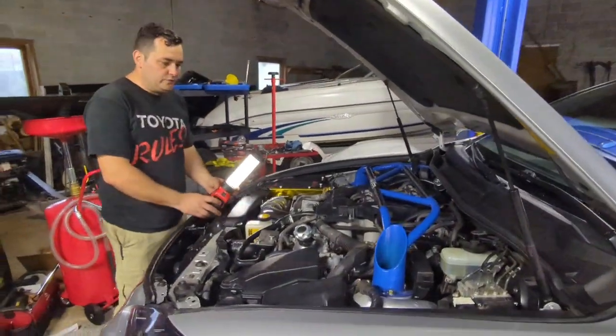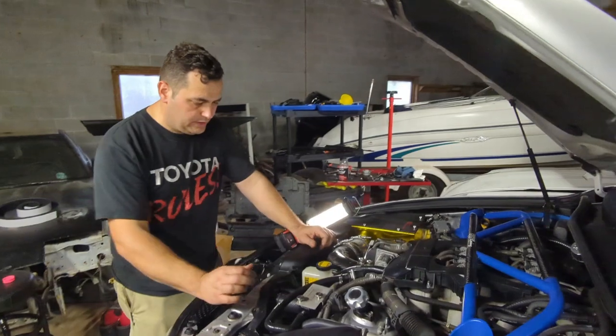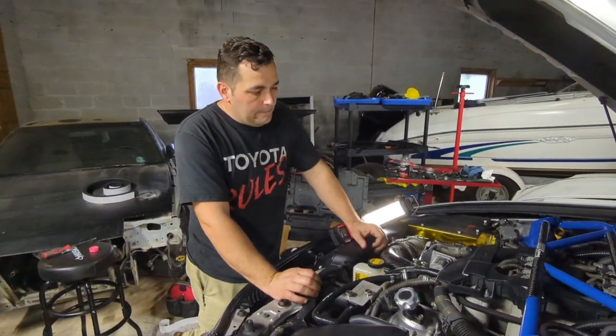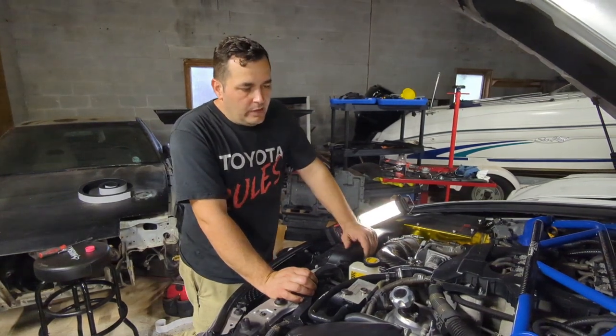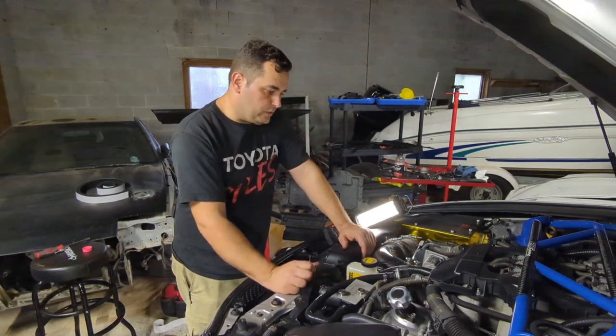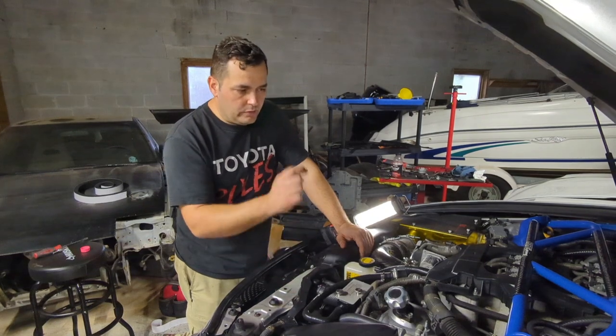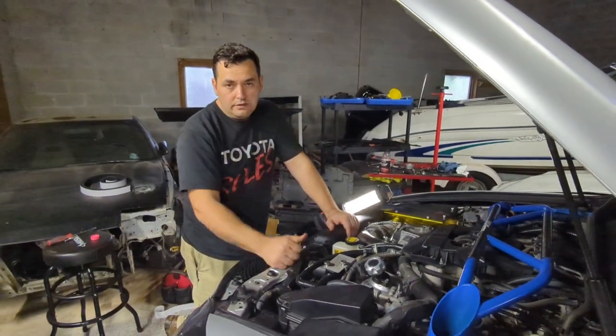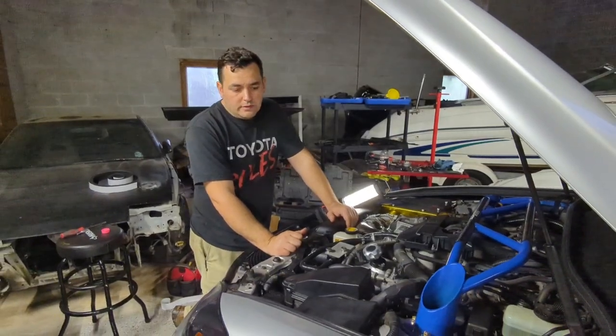Remember that you always lose transmission fluid whenever you do one of these. So it's recommended to do a transmission drain and fill while you're doing it. On this video, I'm gonna stop it there, but I'm also gonna make another video of how to do the drain and fill. I do have one on my channel already, but I'm gonna make one in this particular car. How to do a drain and fill and also replacing the filter in the gasket and whatnot.